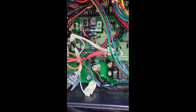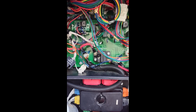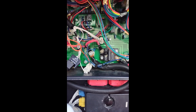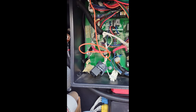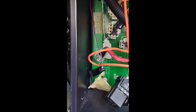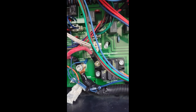It's called a BIRD system. The little board up in the top left of the front run bay, which is below the driver left side, is a little circuit board that controls a large solenoid — very often referred to as the BIRD solenoid — which is in the battery compartment in this particular year and model. You'll see various connections inside this front run bay where the BIRD will actually monitor each battery bank: the house battery and the engine battery.